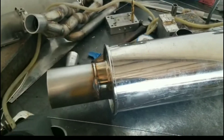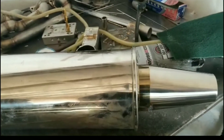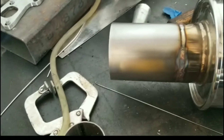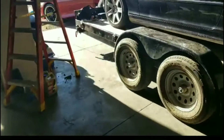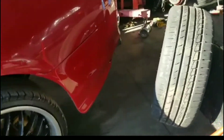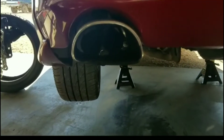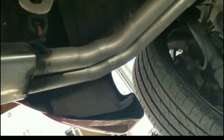What I'm doing is getting ready to put this muffler on my new car - I got a Supra. What I did so far is, since this is a four-in four-out muffler, I put a tip on it and I'm welding up this cone reducer on there so I can get it down to the smaller bit of pipe. I'm not trying to do the whole exhaust because it's not worth it.